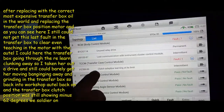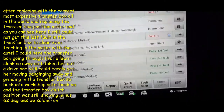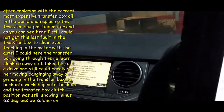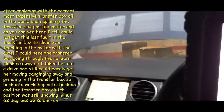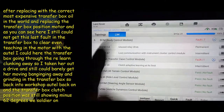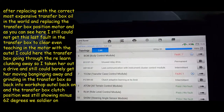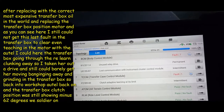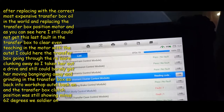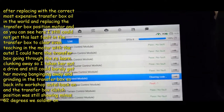Right, so before, what we had was clutch position stuck. Before that we couldn't talk to the transfer case module, which is up under the dash. That was full of grease. We cleaned all that, managed to get communication with it again, and then we had a clutch position stuck fault code, so we put another motor on it. We'll get rid of that code. The motor is on it just from a donor at the minute. So we've refilled all the, we did the gearbox sump on it as well. We've refilled all that with oil. We've still got 2 litres still to put in it.